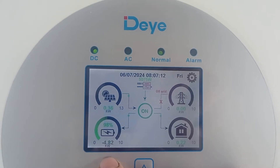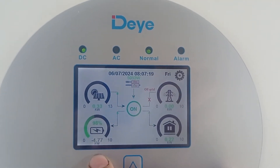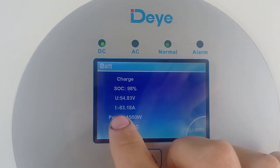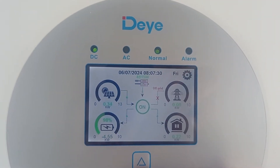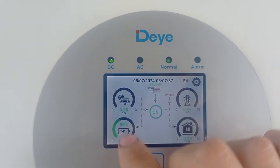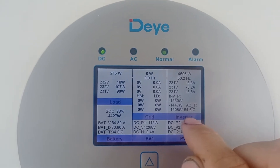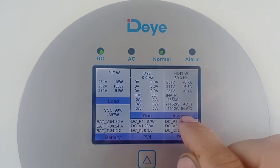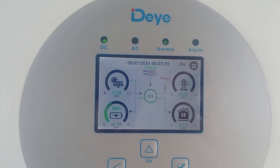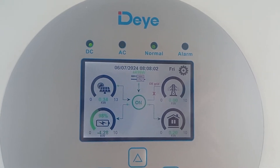You see 98 percent, and the limitations on the charge will continue to rise while the current that flows inside the batteries will be going down and down. In normal operation it can be up to 200 amps because the battery can intake almost 11 kilowatts. Since the total output and transformation values have reduced, the temperature has also started to go down, which is a good thing because the vents were blowing really high and heavy. Let's just wait and see - 4.7 kilowatts going in right now, 4.5, it keeps doing its job really great.